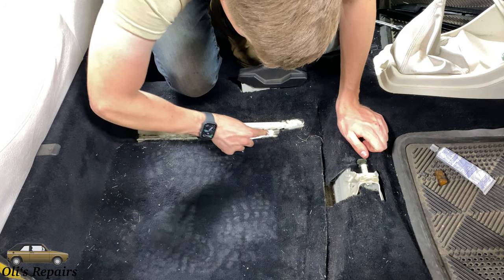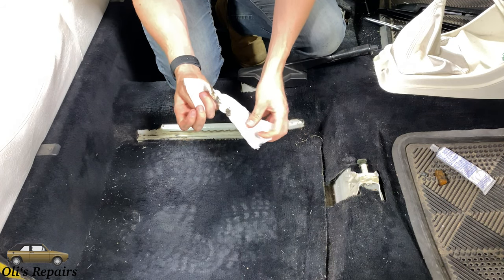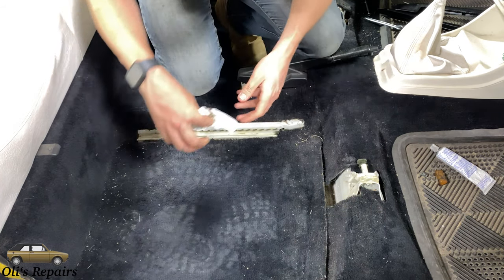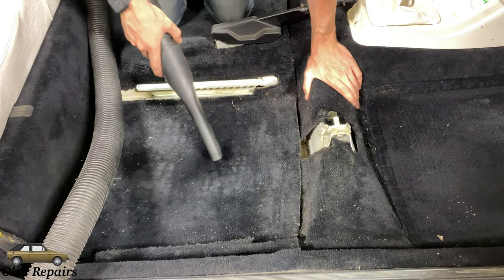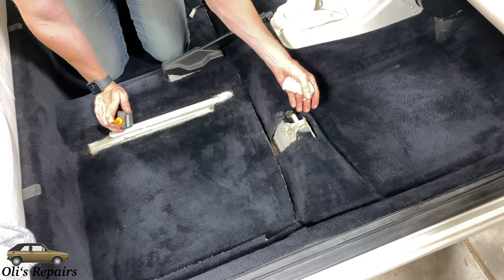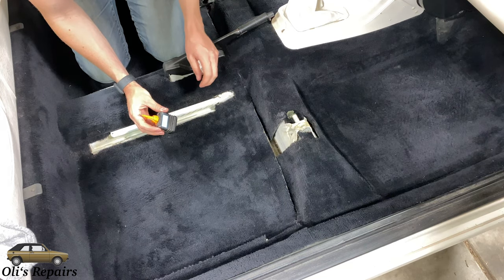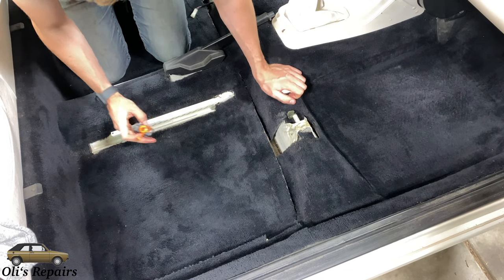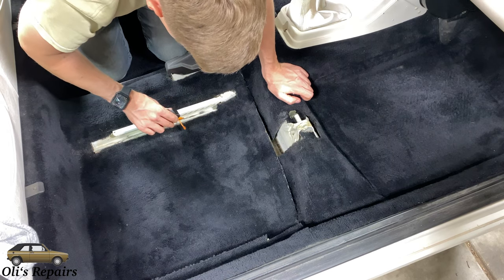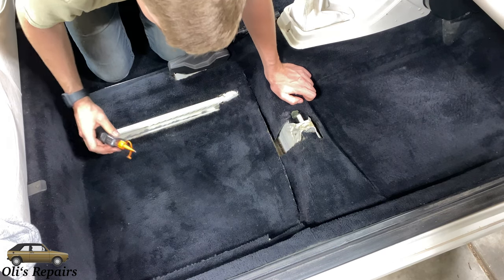Don't forget to clean these seat rails. Everyone always uses grease on these, and that ends up collecting a bunch of extra sand and gunk, so make sure you clean these out very well. When you're in this deep, it's a good idea to give it a good vacuuming, because you probably won't have this good access until you remove the seat again. Here we use a silicone-based lubricant on the elevated area, because that's away from the grime and sand coming in with the feet. Whereas on these rails, you want to use a dry lubricant — I'm using a graphite lubricant here. You don't need very much; it is plastic sliding inside metal, but a little bit of graphite lubricant is always good. Just go in there and give it a few squirts, especially in the areas where it's really sliding a lot, then do the other rail the same way.